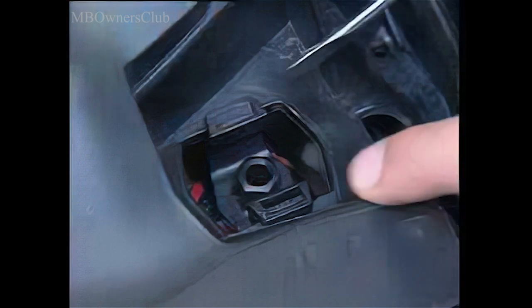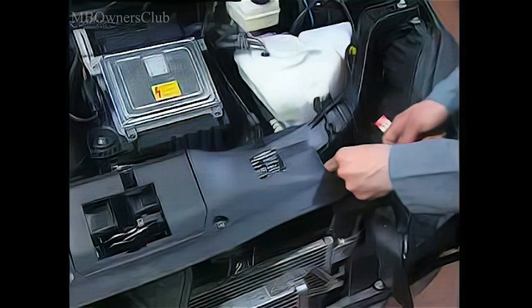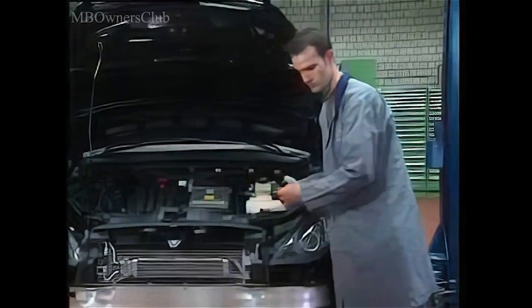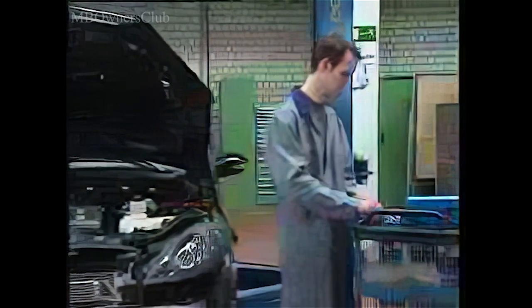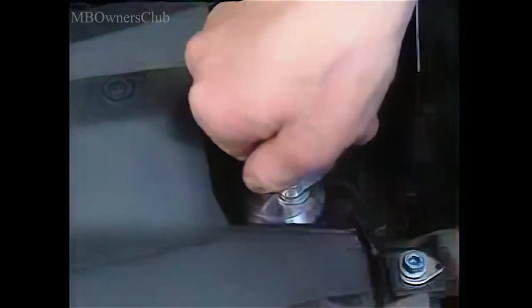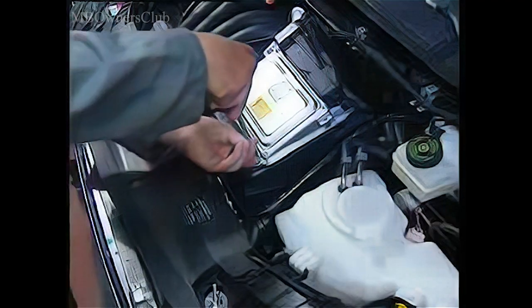The radiator is normally only attached by means of various plastic parts, and the engine holds it to the hybrid carrier, which is where it should stay. For the partial lowering operation, the radiator must be firmly fastened to the body on the left and right using this new special tool.